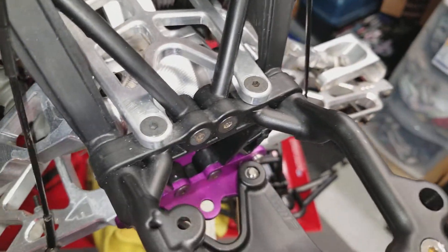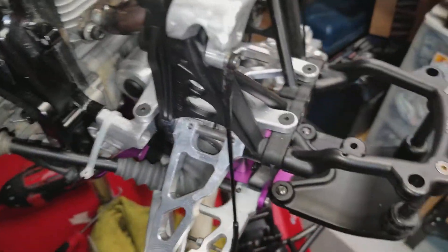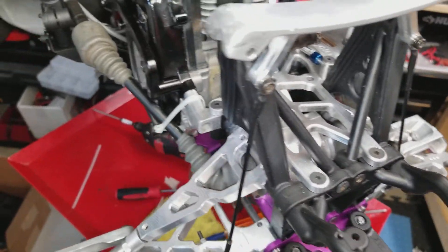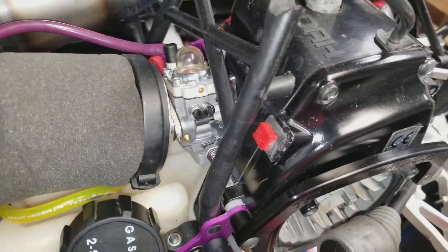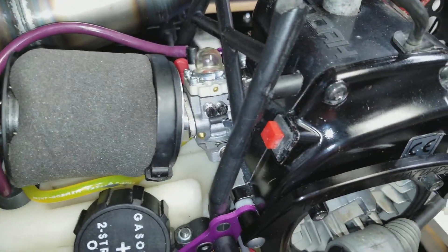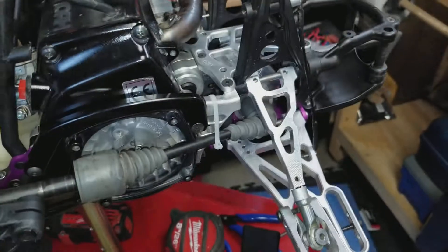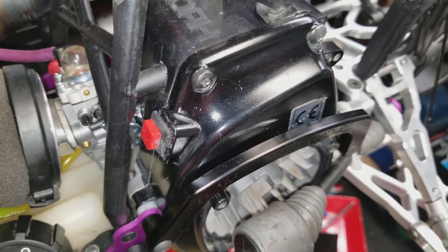I run this thing really loose — about 10,000 or 5,000 weight oil in the back. If you want, you can put a locker in — this motor definitely won't destroy it, but guys who go with big blocks like my 34cc found it undrivable. Everett, a fifth scale guy, gave me a tip: fatten this thing up on these dials, meaning you're making it too rich. That way it keeps the motor cooler and there's not so much power in the back. If you're racing, what good is power if you can't control it? The settings I have on this I will revert back to stock.